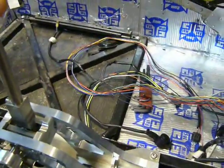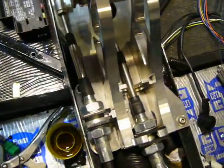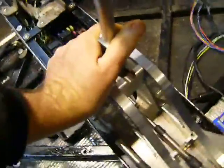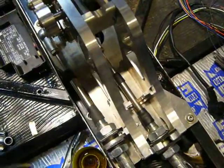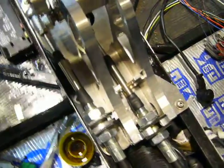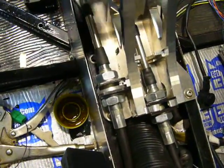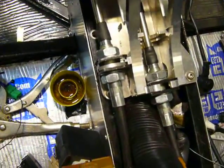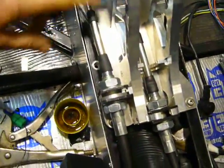The other thing is that the cable moves quite a bit before you actually get movement from each side of the shifter at the back of the transaxle. If you move the back of the transaxle, which I'll do in a second, you'll see how far it can move. The movement is right around a quarter of an inch down there, but the distance to the shift knob is about two and a half times that. I'll have to measure it from the pivot to the knob versus the pivot to the cable mechanism, so the movement down here is effectively two and a half or three times as far up here at the knob.